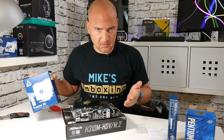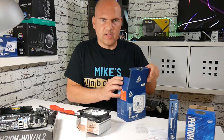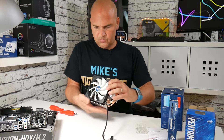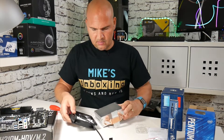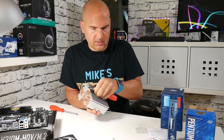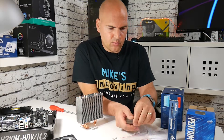We've done the mounting of the CPU onto the board, now it's time to get the cooler ready. I've used this cooler before so it hasn't got any heat paste on it and the fan is already connected. First thing we need to do is remove the fan to gain access to the screws on the bottom — flick up the spring clamp and the fan comes away nice and easy. Now release the screws on both sides and put them somewhere safe. On the actual cooler base, there's a slot next to the screw where the mounting brackets will rest in place.